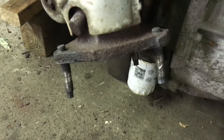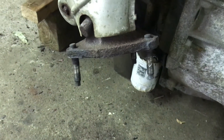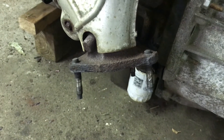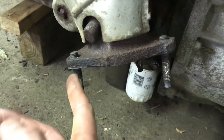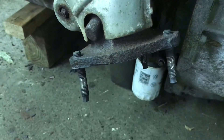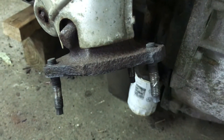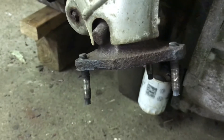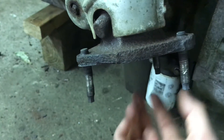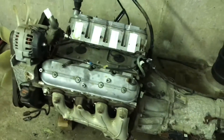As you can see here, I paid hell getting these bolts off. I had to cut two out of the three of them off because exhaust bolts, like I said, they're always a bitch. They're just heated to extreme temperatures while they're in use, and then they heat, they cool, and they just pretty much end up welding themselves into place over time. I got these things glowing red hot, and once I got them glowing hot I was able to get them loose, but once I got them loose I was only able to spin them maybe four or five times until they just started free spinning. So I ended up cutting the first one off, and then the second one, same difference — got about four or five turns and I just felt it start tearing into the threads, so I just cut it off and tried to save what I could. Worst comes to worst, I'll probably just end up having to stack another nut on there to take up that space. But I'm glad I did those things while the motor was sitting right here as opposed to trying to do it in the truck, because that would have been a nightmare.